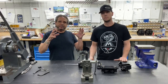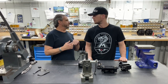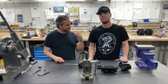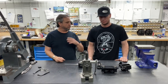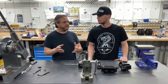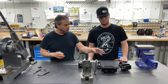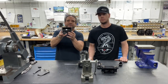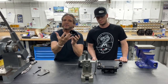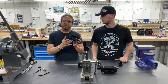What we've got back here are some float bowls. I was talking with Joe about my own carburetor — it's a Pro Systems — but we're going to switch, try a twin blade. I just got the engine running, I'm going to take it to the strip, run it with what I've been running for 25 years, and then we'll see how your carburetor stands up — try a 4150 and try a twin blade. This old float bowl we've always seen before is APD's proprietary design; same appearance as a Holley but with way different design features.